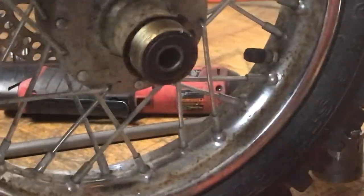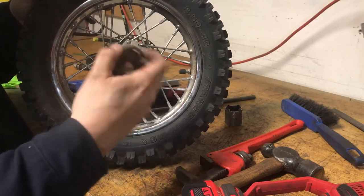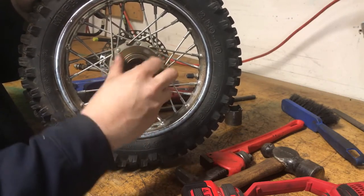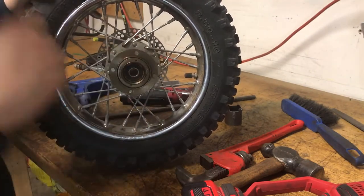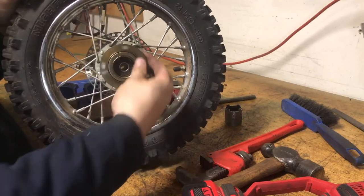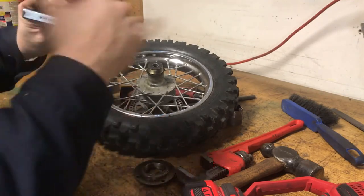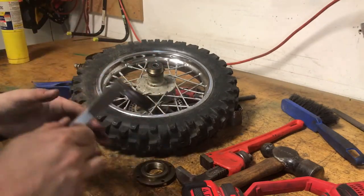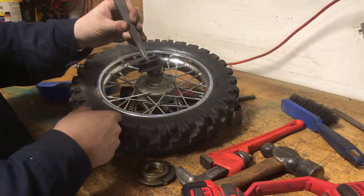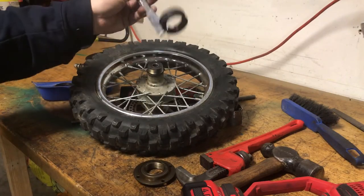The next thing we'll do is we'll tap the bearings out and put some new ones in. I'm going to just test-fit this on here, make sure it screws on okay. Make sure you're not cross-threading because this is a super fine thread. It fits on there fine, even off that cut. It looks like the fastest way to do this is cut the outer race of the freewheel, knock all the balls and everything out, and then split it. If there's just a little cut on the threads it's not going to hurt anything — as long as you cut all the way through or a majority of it, once you start hitting it with the chisel the spreading force will break it. Once it spreads, just swivel that thing off. Boom, that's done. I think the next one I can probably knock out in about five minutes.